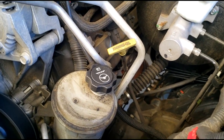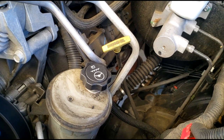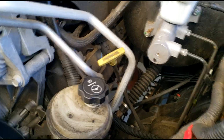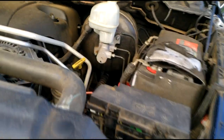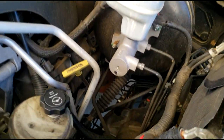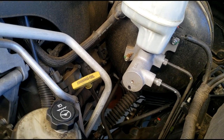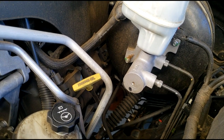Not a ticking noise. Ladies and gentlemen, that is an exhaust stud. I will run that by him and see if he wants to get that fixed. If he does, we have some more content coming up. All right? Yes, it's on that side. Exhaust stud broke. It's not a Hemi lifter tick. This is a Hemi. I heard it when I first started it. Tick, tick, tick, and it slowly subsides. But yes, that's what that is.